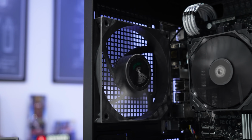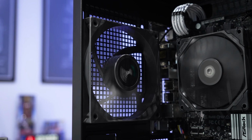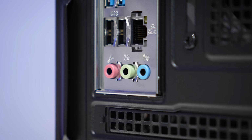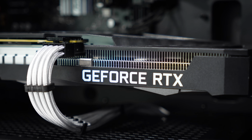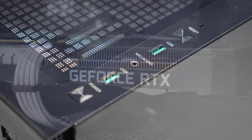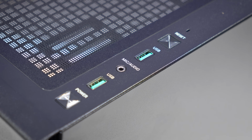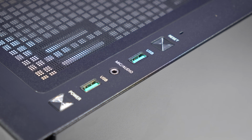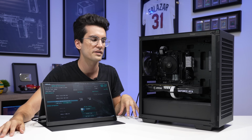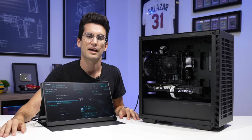The next step from here is going to be to install Windows, whatever your preferred operating system is. A majority of users are going to prefer either Windows 10 or 11. And then after that, just install your drivers. Graphics drivers are going to be your biggest one. If you need maybe Ethernet drivers, internet drivers in general, maybe you have a Wi-Fi adapter, Bluetooth adapter, you might need to have those. Once the internet drivers are taken care of, then you can use your own PC that you just built to download everything else. So those are going to be the 2 or 3 crucial ones, and from there pick the programs that you'd like, and yeah, happy gaming.